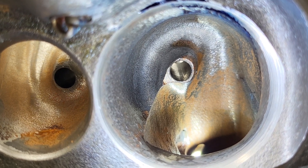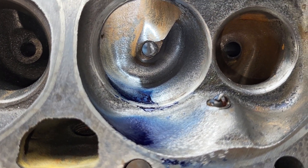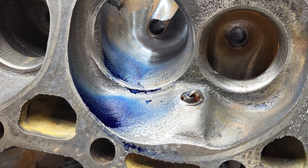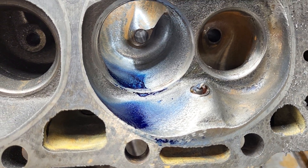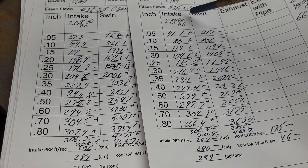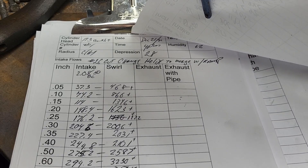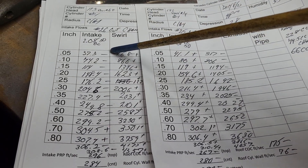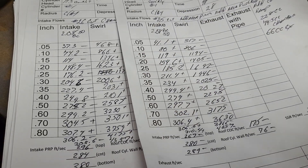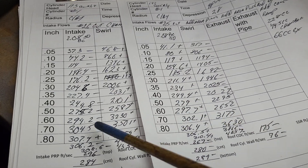Let's take a look at a different view of this and then go to the numbers. You can see some rust in there, but as far as our liquid is concerned, it's not bad. I think it was a little better last cut, and our flows were a little better last cut. So let's compare them. This was our 25th cut; this is our 26th cut — the only thing I did was change the helix to merge with the ramp differently. The results: mostly minuses across the board. Loser. Take a look at how big a downer we are. Ouch — painful.